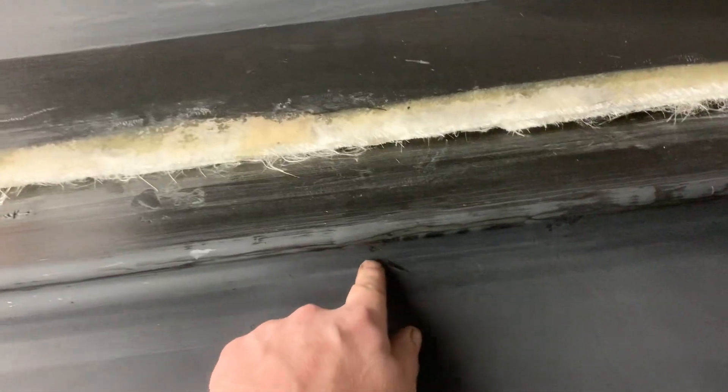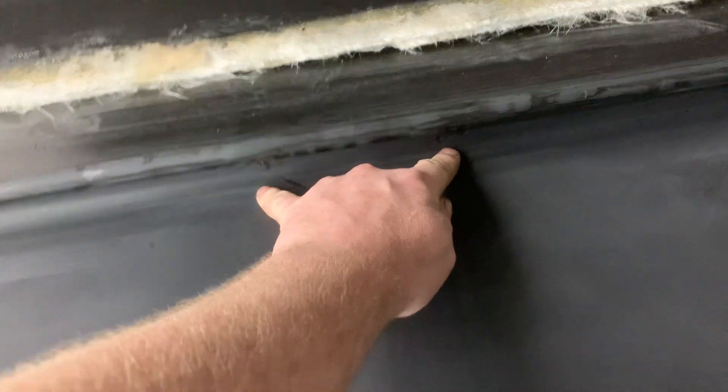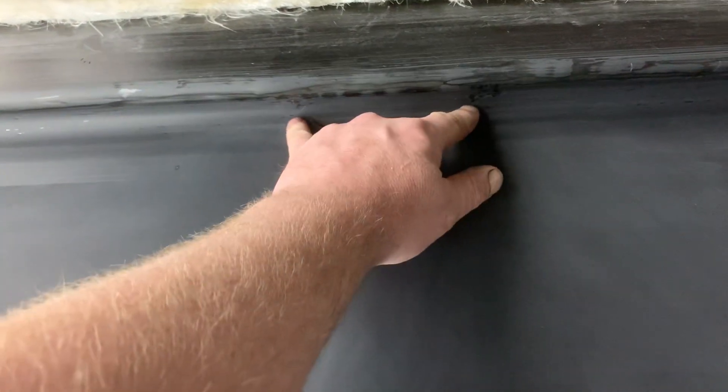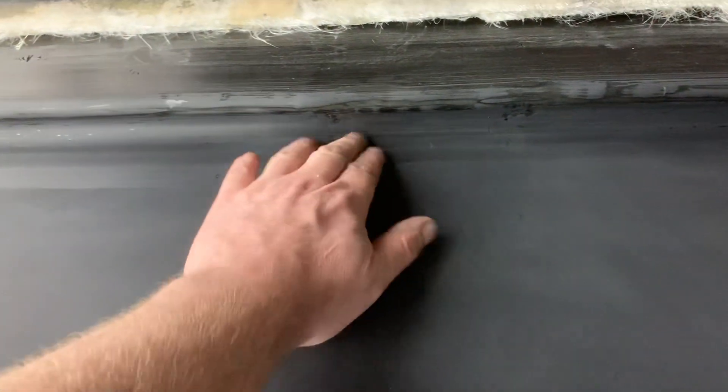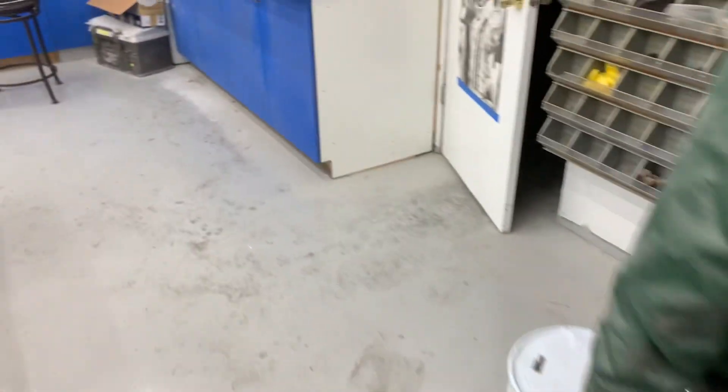The rear wing molds - I've run out of gelcoat. I need to do a little repair here where I took the molds off the original wing; it had two big cutouts since it was a single-seater wing. I filled them up with wax but there's a slight shift, so I need to add a bit of gelcoat to get that smooth. Then I can put wing mounts, end plates, whatever I want. It's not the cheapest material either, so we'll wait until it's been ordered.